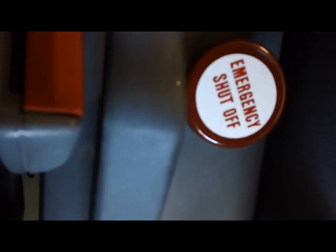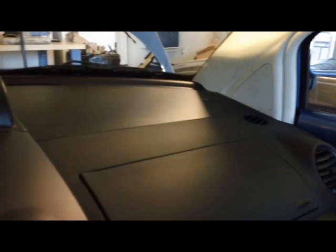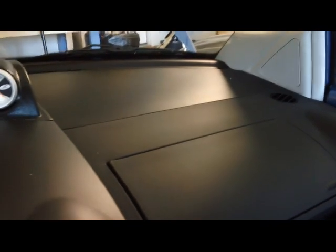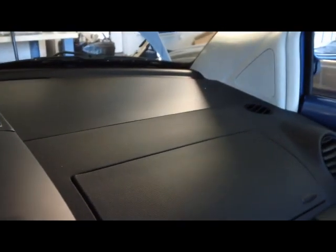Inside the car, between the two seats, is the emergency shutoff pull — just a manual pull so I can cut the motor off at any time. There's also a switch for the heat. The heater is sitting underneath that panel; I pulled out the filter and put a heater core in that space. It runs off the high-voltage 140V pack. It's a really good ceramic heater — you need the fan running because cold air moving through it actually makes it get hotter.